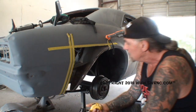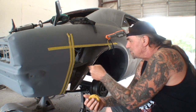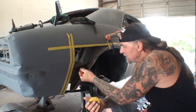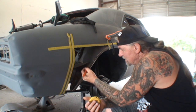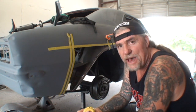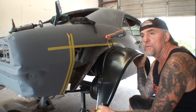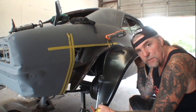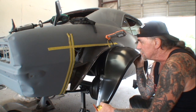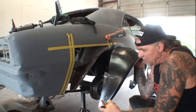Remember to tell them the outer. On our particular car, what we found is that ours is rusted to approximately right here, right where this little beveled edge is. What I've got to do is actually cut this out right here, and I have another inner outer fender well to replace it with. I don't want to replace the whole thing because the whole thing doesn't need replacing — we're trying to save time, money, and hours. So I'm going to measure this out and then transfer my measurement onto the new piece.